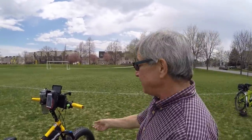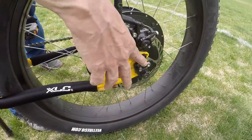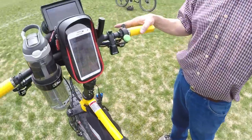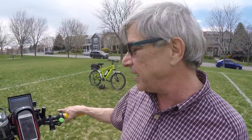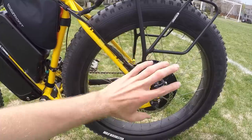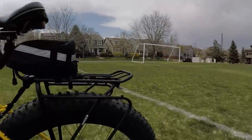Does it have regen? This does have regen — I've got it at 14 amps of regen, but it's adjustable to whatever you want. The BB7s came stock — that's the Avid BB7. They're not hydraulic, they're cable mechanical. I've added a mechanical switch in the brake — when you first touch the brake, it jumps into regeneration first. That's usually 90% of what you need to brake. The Falcos from time to time have a mind of their own, so having a cutoff is a great workaround.